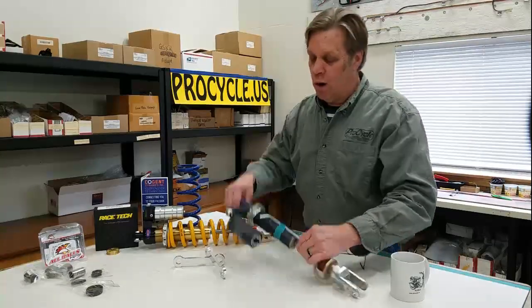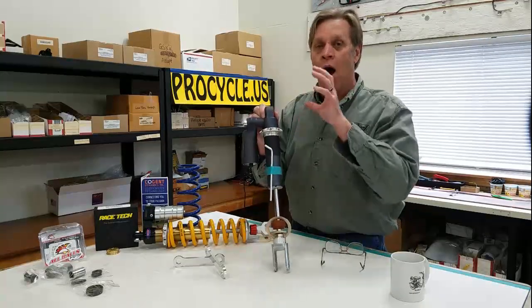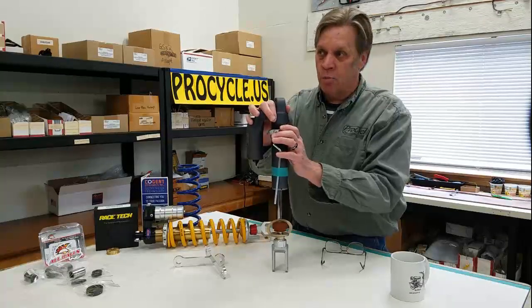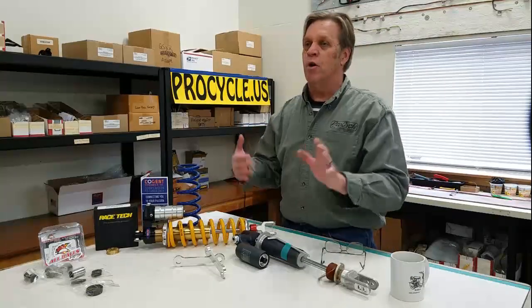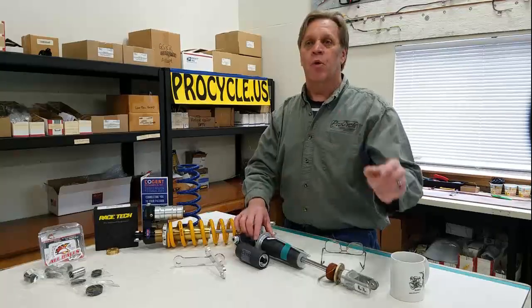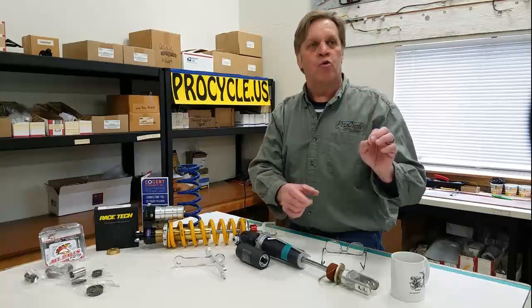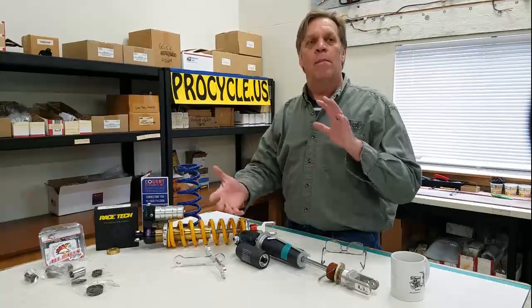If it's more or less than that, what you want to do is take your ring adjuster and lengthen the spring to allow more sag, or tighten it by compressing the spring which will give less sag — that puts a little preload onto the spring. You also want to set your front suspension up the same way. You want the front and rear to match, so if you set one-third of travel on the rear shock, you want to adjust your preload spacers, shock springs, and fork spring spacers so the forks also compress the same amount. You measure from the top of the fork triple tree down to the axle to see how much the fork compresses — again, when sitting on the bike, you want about one third of travel.